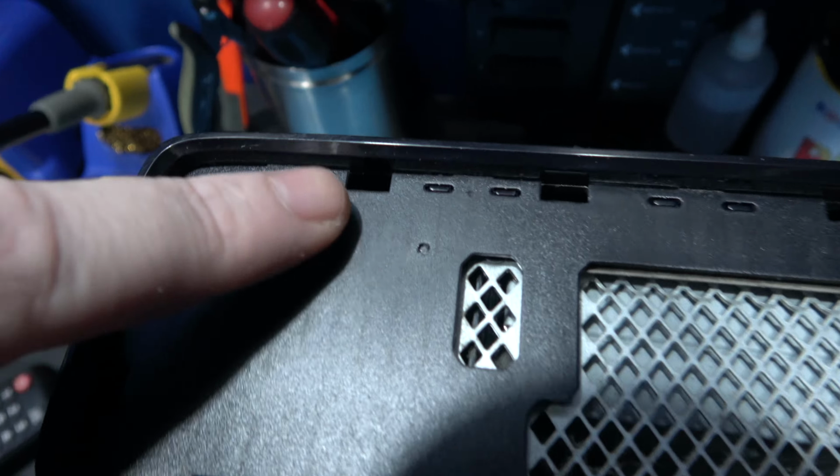As you can see, I've hooked up the JR programmer and I've got JRunner running. Just to prove to you that it's recognized the Xbox flash, I'll press the question mark, and as you can see, it's come back with a valid flash configuration. It even knows the console's a Corona. So what I'm going to do now is read the NAND. I'm just going to press read NAND, and it should start dumping the NAND.